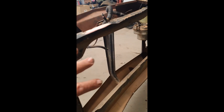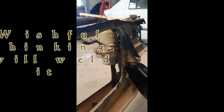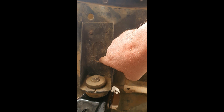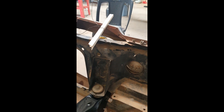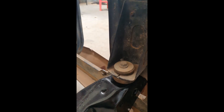All I need to know are my clearances for my radiator, which is on this side anyway. I'd pretty well guarantee I'm not going to need to drill any holes or do any welding - I can use original bolt holes and make my own bracket for that. All I need is my air conditioning condenser and maybe one hole here for the bracket. I'll order the power steering lines and they'll come out on the inside of the rail, straight across to the power steering.